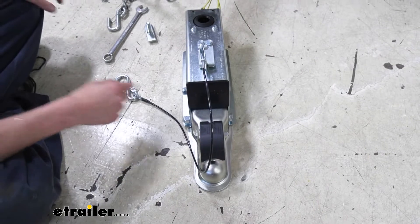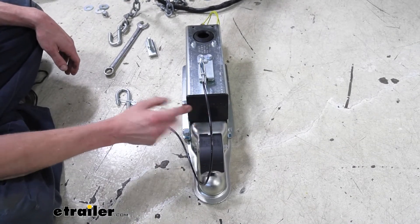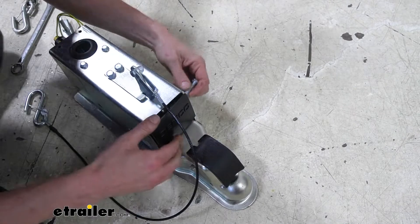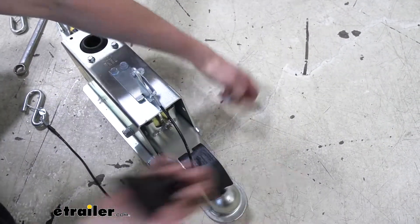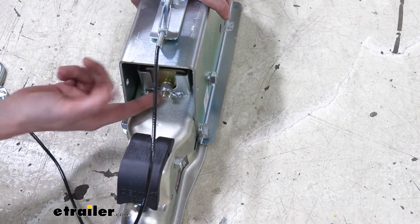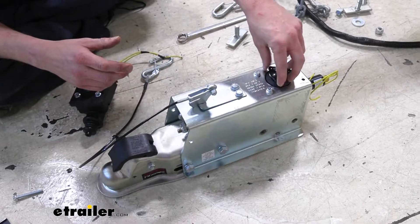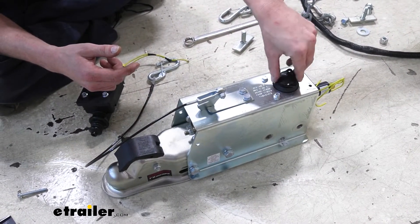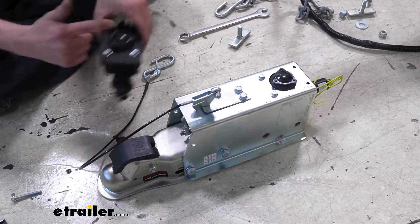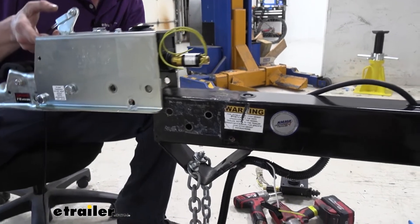You may be wondering how to access the actuator to push on it without hooking it to your trailer. This cover here is removable — you can push in a little tab on the sides. Removing it first makes lining up the piece a bit easier, though the big U-shape makes alignment fairly straightforward when sliding it together. With the new one installed — we used a drum brake actuator here — the procedure to replace a disc brake actuator from Demco is exactly the same. Just make sure you have the appropriate actuator for your application.